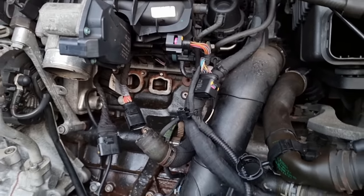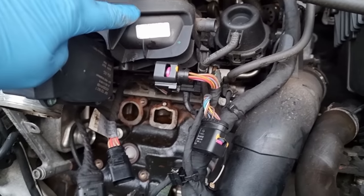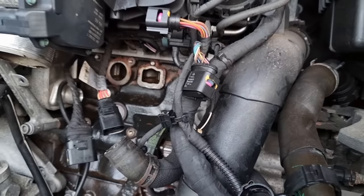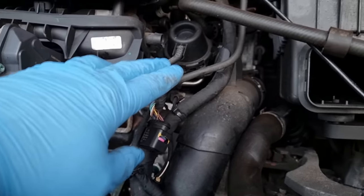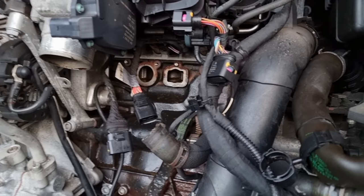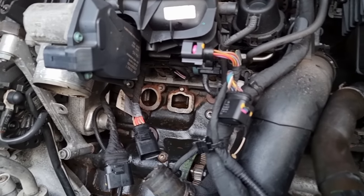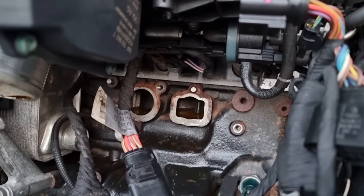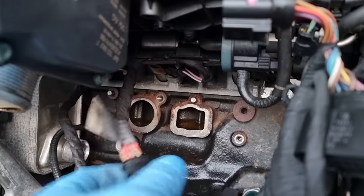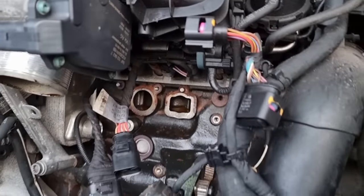I have seen videos on how to do this. Looking at it, more often than not, they take the manifold off and come through the top with the front still on, but you've got to take the manifold out, you've got a lot of fuel pipes to remove, and access is really bad. Ultimately, I would say the best way is taking the front off, time-wise. So it's not a good job either way, and you're talking over £1,000 at Audi or Volkswagen to do this job. So it's not a cheap job either. Obviously, because I'm doing it myself, I'm going to save an absolute fortune.